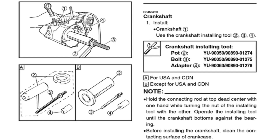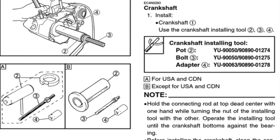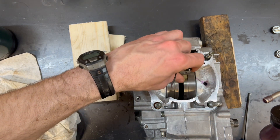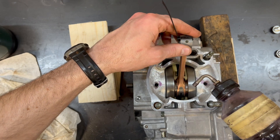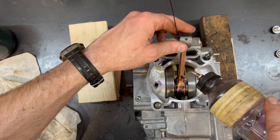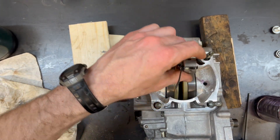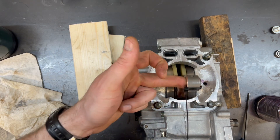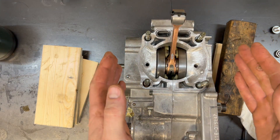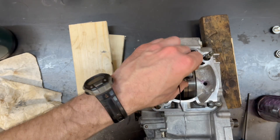Here's a picture of the OEM Yamaha crank puller. You can see that it bottoms out against the case, not against the inner race. The advantage with this puller is that when it's all said and done, the crank bearings have no side load — but during the process it puts a tremendous amount of load on the bearings. The effect is the same as if you were just to pull the crank cases together with the bolts. If you use a puller that pulls against the inner race, it's very easy to pull too far, and then tapping them will make it worse. None of this prevents me from assembling the engine in the left-hand case half, but the right side case half has a nice flat surface and sits on my 2x4s a lot better. With this method, I can have the engine sitting in one spot the whole time and keep the side loading to an absolute minimum. It's also just a lot less work.